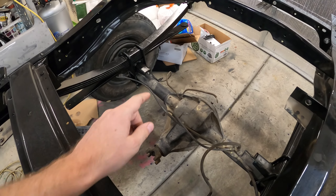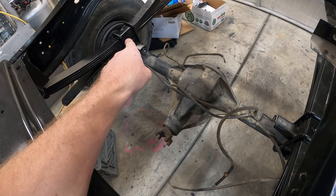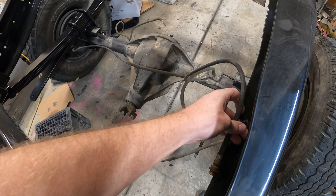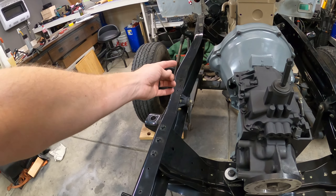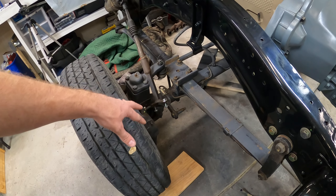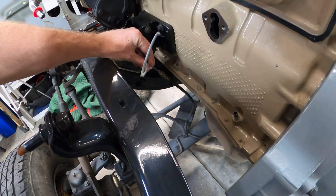I'm going to admit right now I have never done brake lines before, but I think I can handle this one. In the rear, we've got the line that comes from the passenger shoe and it's been broken off, so we'll probably make a new one. The driver one is just fine — it runs up into the frame rail. We're going to run that line all the way up to our brake combination valve, which we're going to mount, and then that'll go up to the master. In the front, both lines to both disc brake sets are good, but the line coming up to the combination valve is no bueno, so we're going to make that one.